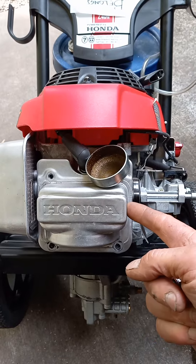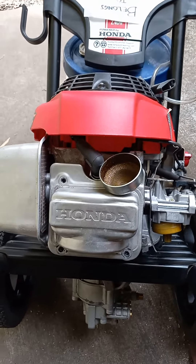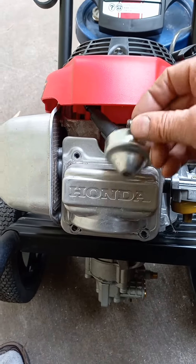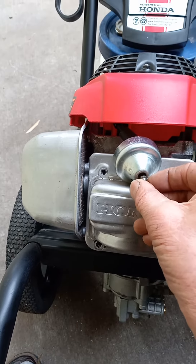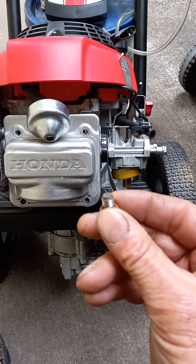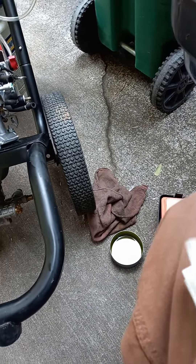I can't get this off to save my life. This unit doesn't belong to me so I went a different route. I pulled the bolt out of the bottom of the float bowl reservoir — whatever you call it — and it was just covered with grimy black goo.